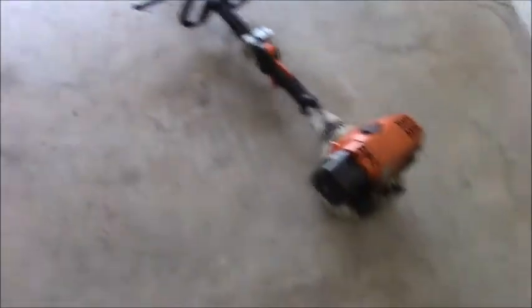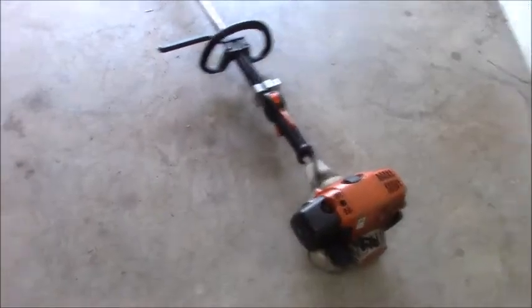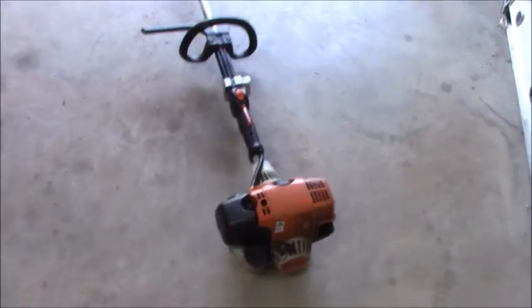It has a little over 30 cc's. The only maintenance I've ever done to this trimmer is change the air filter — it got so gummed up that the thing wouldn't even run, so I changed it out and it fired right back up. It's got plenty of power; it's knocked down saplings about the size of my thumb. It's going on three years and hasn't really had many issues. With it being three years old, you can tell just by looking at it how worn out it's getting — it is getting hard to crank.